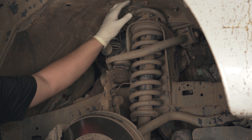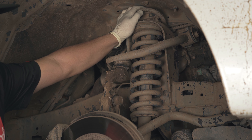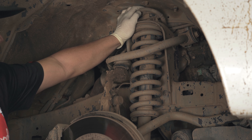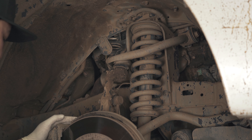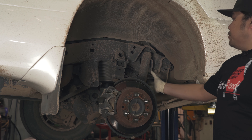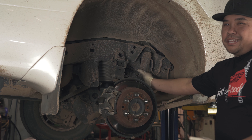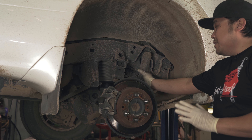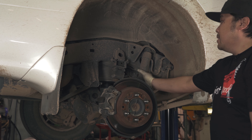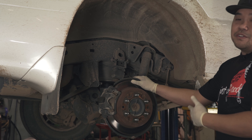We're going to have to take off the internal dampening system for the suspension. Since we're going to be putting in our four-step adjustable suspension, we don't need the dampening motor or anything like that. We're probably also going to replace some of the bushings on the suspension arm and move on to the back. For the back, we're probably just going to replace the shock with a longer four-way adjustable shock and modify the air spring a little bit to get more stroke out of the whole system. Knowing Brian, he's going to thrash it pretty hard, so we need to do as much maintenance on the suspension as we can. But first we definitely need to take this thing outside, wash everything, and blast all this grime and dirt off the car.